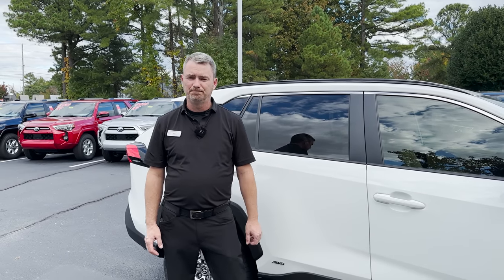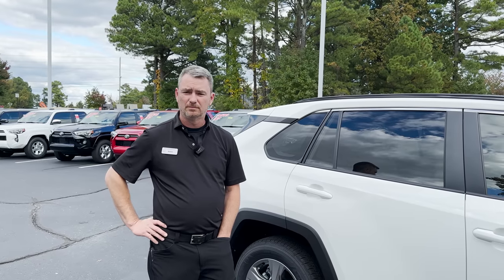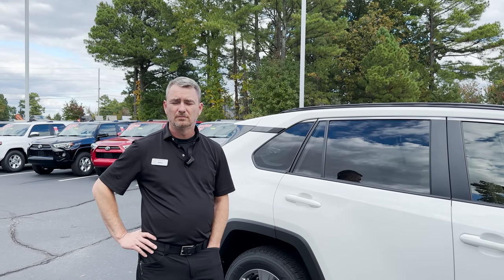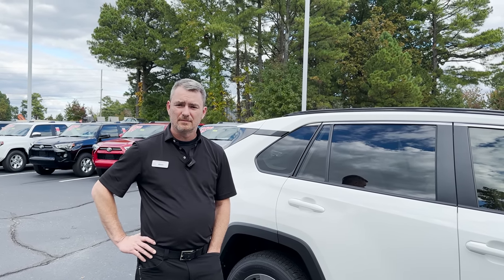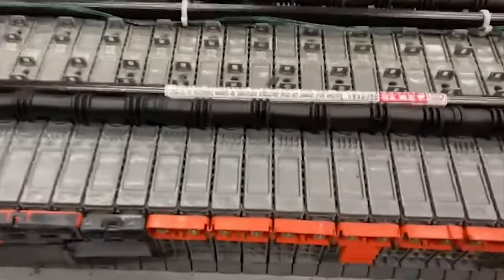For the all-important question of finance and economics — let's say one is starting to go bad on an older Prius. You can replace the individual cells or replace the whole hybrid battery pack. When would it make sense to replace individual cells? We've seen a small grassroots movement toward some second-gen Prius owners wanting to replace individual cells or battery modules. Our experience has been varying levels of success on that repair, so we haven't offered it here because we can't guarantee the efficacy. On the newer models, pack availability isn't as strong, so we really don't advise getting in there and trying that.